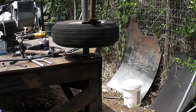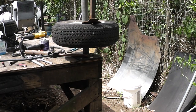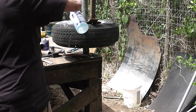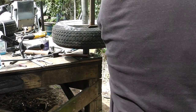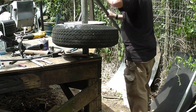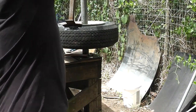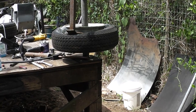There are a lot of things I want to throw in there too. If you don't lubricate the back side of that tire when you break the bead, I've had them where the bead sets back up again somehow and it's murder to get it off — you have to go through the whole process again. So put a little lube on it. Let's flip it over and do the other side and put that other tire on too.